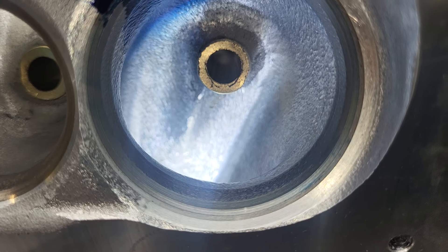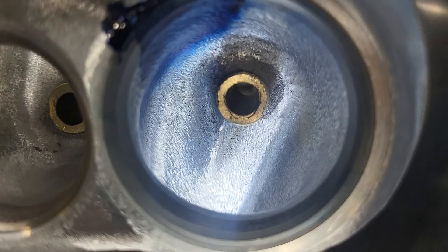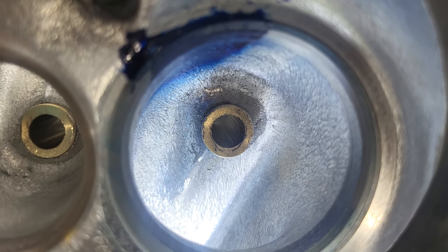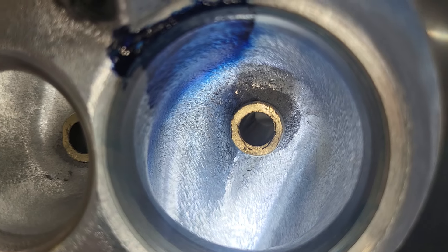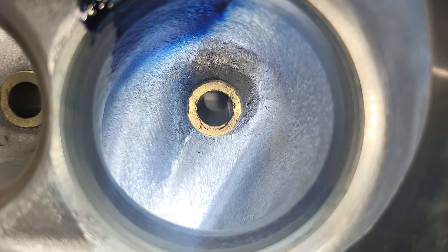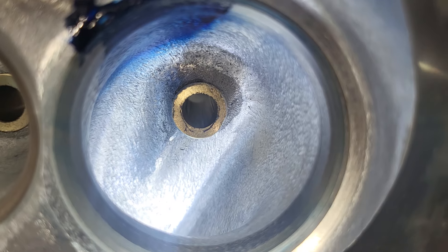We really don't see anything on the back of the exhaust valve. As far as the port shape, it was changed a little bit — I went by the air speeds and changed the bowl a little bit. You've got to be careful, these bowls are not thick. If I really have to push my luck I'll have to change the texture, then measure, then grind, then put the rough texture back on. A rough burr can get you in trouble in no time.